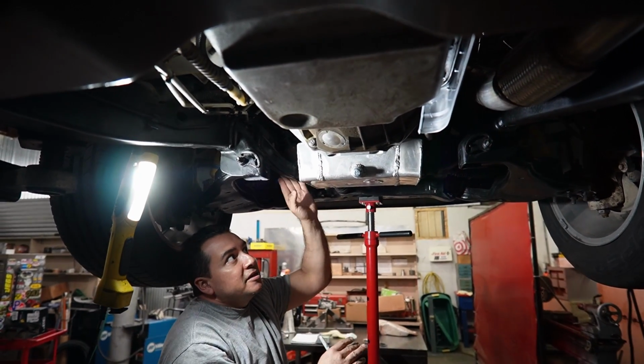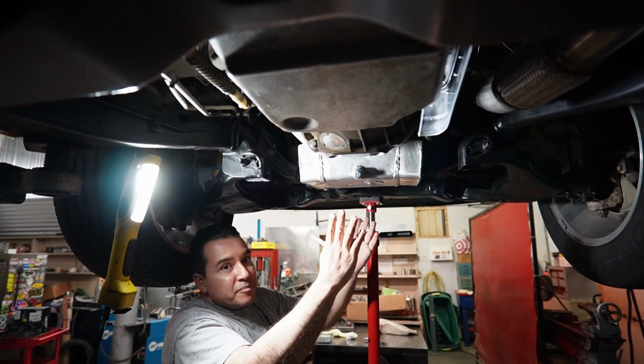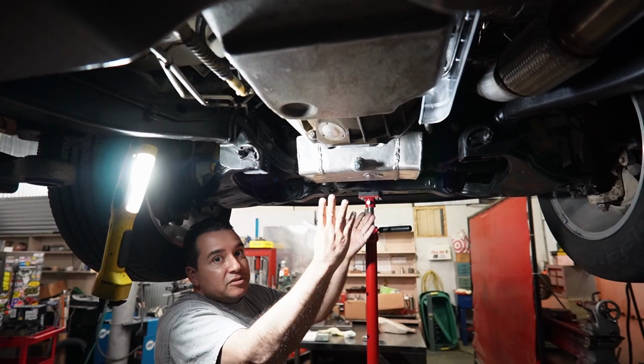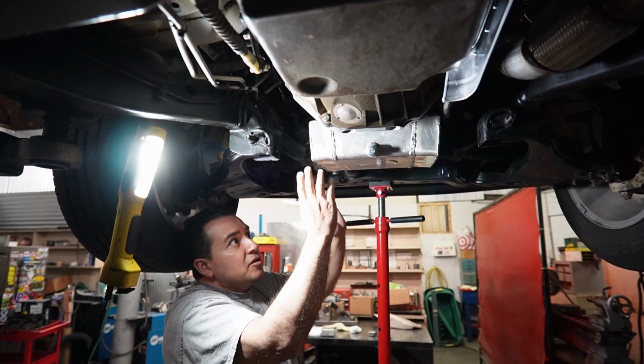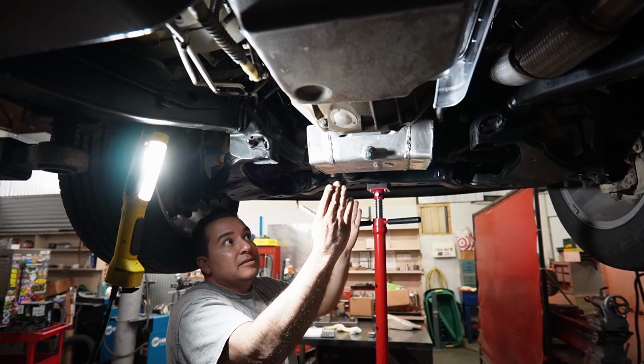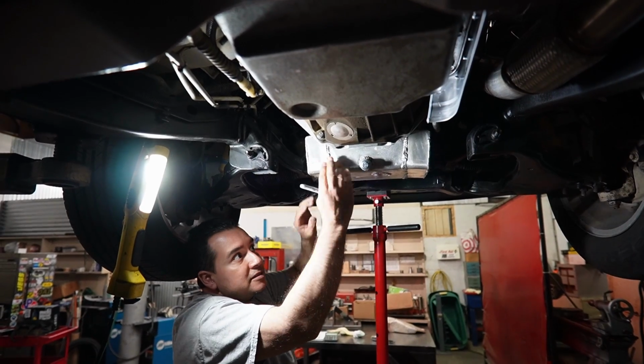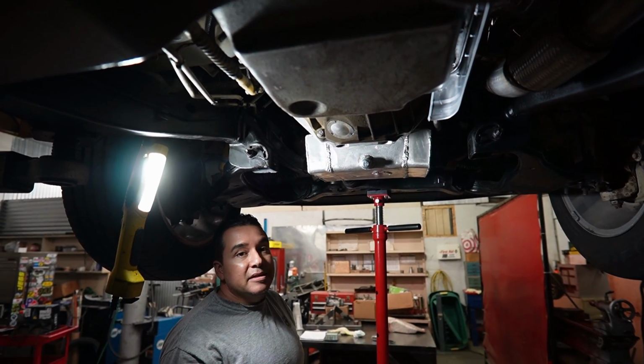bit doesn't clear, but there is plenty of room to have a rear sump modified pan from the 5-cylinder, or a custom pan, or these M-Tech pans. Anything rear sump that you make is going to fit this chassis. So this one's 5. This was the 5-quart pan that I kicked out, so it's now about an 8-quart pan.